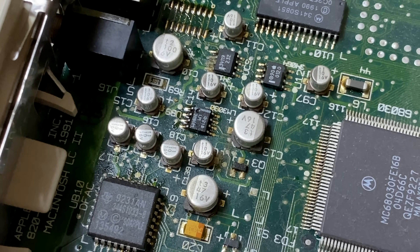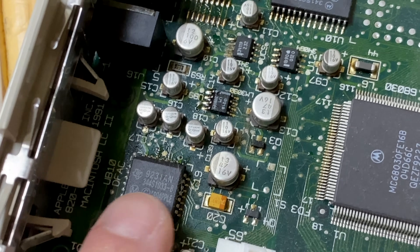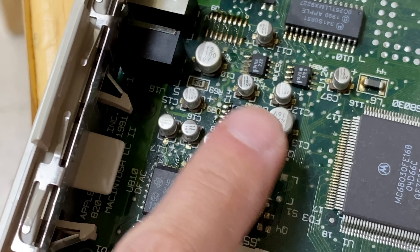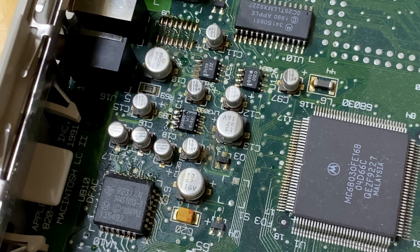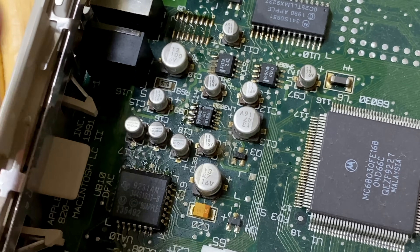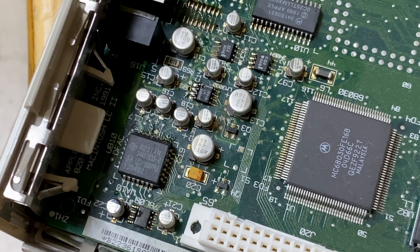I am, as probably to be expected, seeing some signs of capacitor leakage on this board. It doesn't look severe — I think this is all stuff that could be cleaned up and fixed. But that's the other thing you need to do with these older machines: take the battery out first and foremost because those will still do the worst damage. These caps — the electrolyte that leaks will absolutely eat away at traces on the motherboard, lift pads, and get underneath chips and become a massive pain. Electrolyte is probably hiding underneath chips like these, so you need to really clean these boards very well, or just take the chip out so you can clean underneath it.